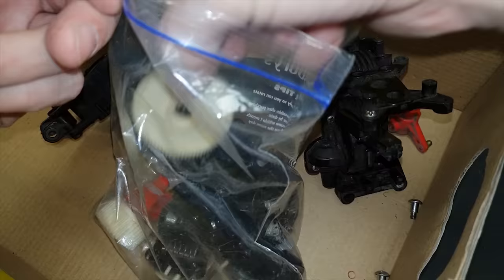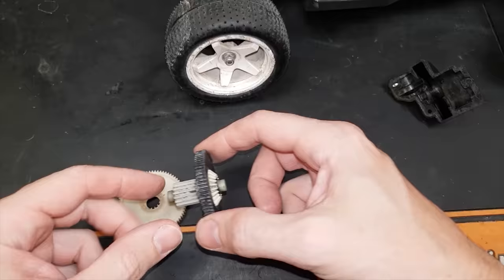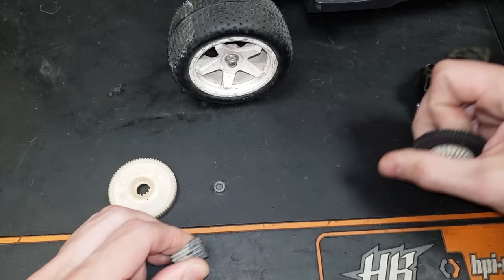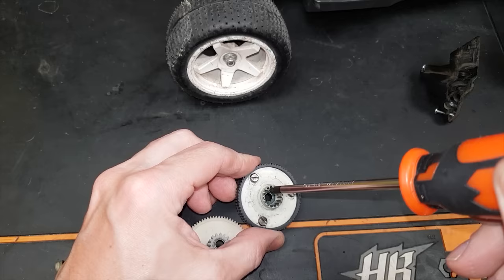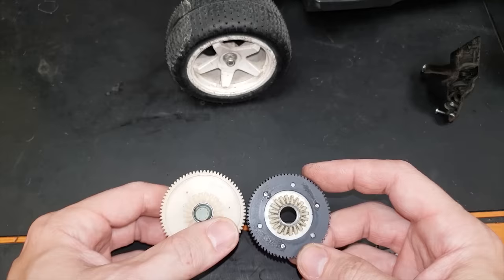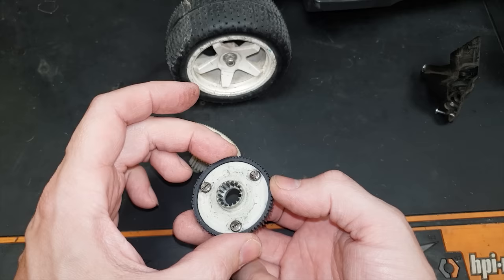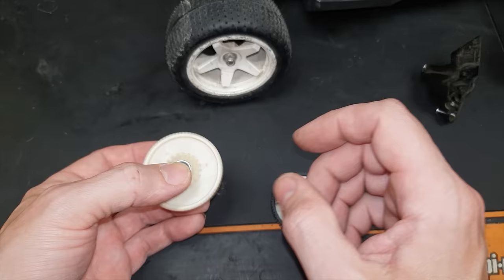The one from Mark's car actually looks to be in good condition - cheers Mark! So hopefully I can get these insides out. What RW Racing did - I'm pretty sure it's RW - they machined off the main tooth part and made separate ring gears so you can put on different gear ratios. That was actually a much better idea because when you strip these, you only have to buy the ring gear, not the whole gearbox.